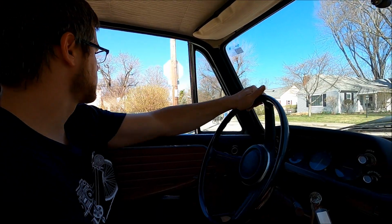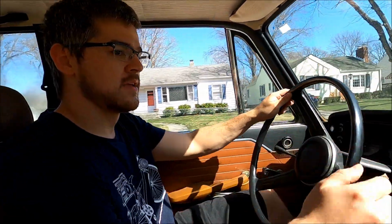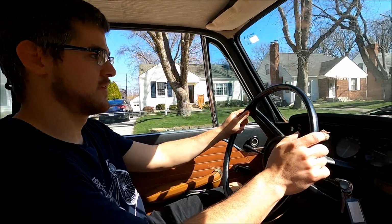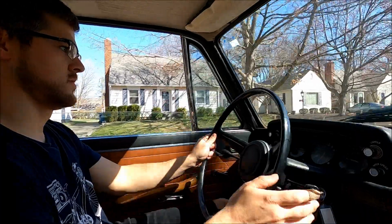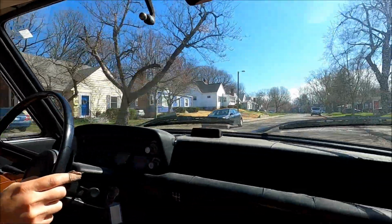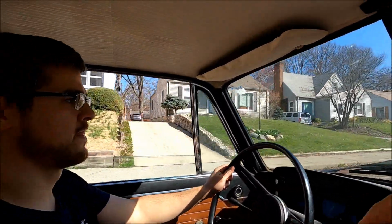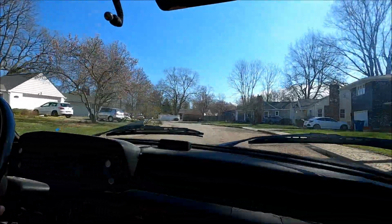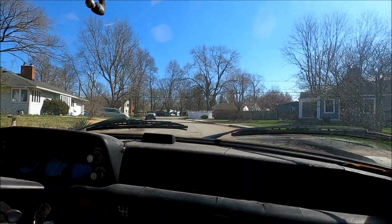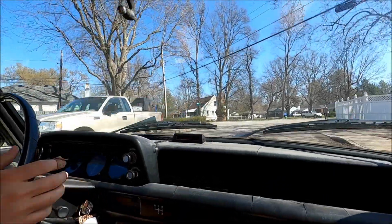I keep hitting the wrong side for the turn signal. Yeah, it's on the opposite side. I feel like it almost keeps dying when you start engaging in first. Kind of. I think that is the exhaust. Yeah, that rattling there was definitely the exhaust. There was some squeaking happening up front too. Suspension. Yeah, you hear that? Like a rattling, high-pitched noise.